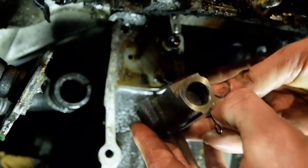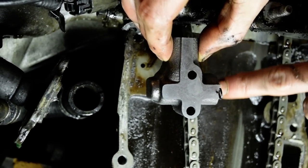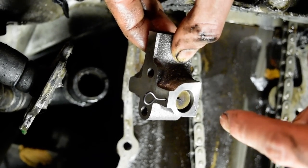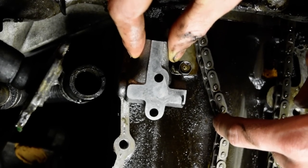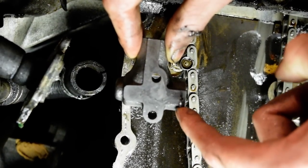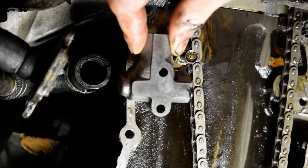This tensioner fits just like that against the block. You have a timing chain guide over here — here's where the piston is. You pull that pin, there's a spring in there. It pushes that piston out, and then oil pressure pushes that piston out stronger, so it keeps that guide tight against the chain. The problem is not the guides — the problem is the spring inside this tensioner. Once the oil pressure builds, oil pressure maintains the tension, but the spring itself is not strong enough on a dry start.